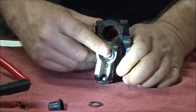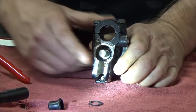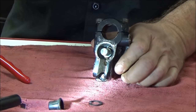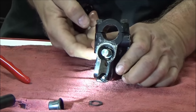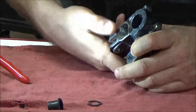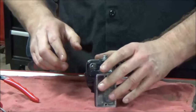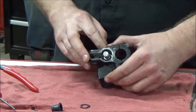I'm going to add some more brake fluid and get this really well lubed up. When I get it right here, watch my technique - I'm going to walk it around. If I just shoved it in there, what I call the umbrella seal would just fold over on itself. I need it to be facing the right direction in the bore. Now I know you can't see down there, but I'm being really intentional, watching down here. The tricky part is doing this all at the same time while putting the snap ring in.